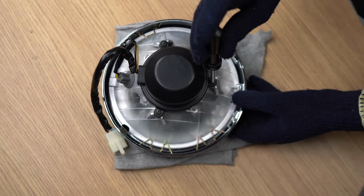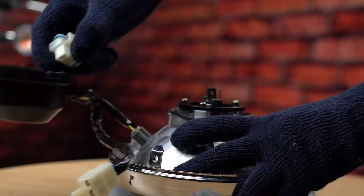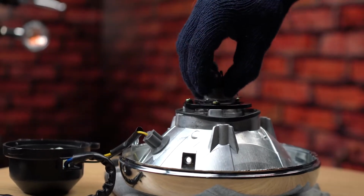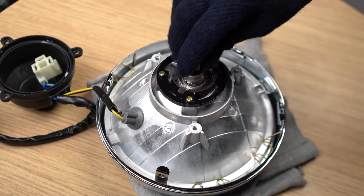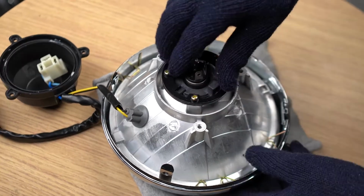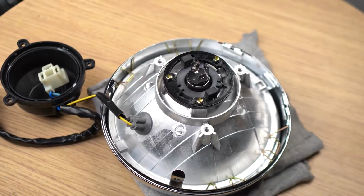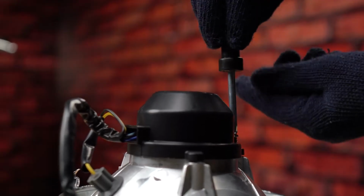Remove the headlamp boot rubber from the reflector dome by removing three screws and push the headlamp locator clip to slide the bulb out from the slot. Now fit the new headlamp bulb by locating the three slots provided to fix the bulb. Lock the clip carefully by pushing it into the slot. Fix the rubber boot on the top and tighten three screws.